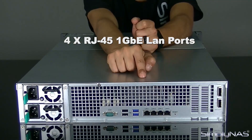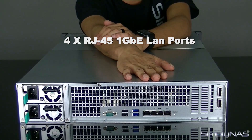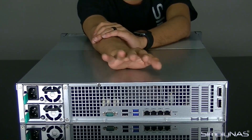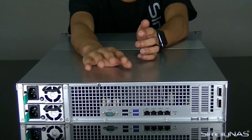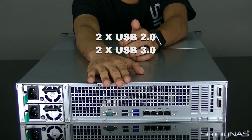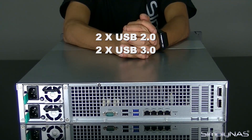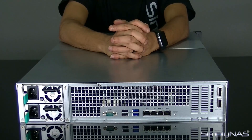Going through to the middle of the NAS, you've got four RJ45 ports, allowing you a four-gig uplink. These can all be aggregated together because they are on-board, so you have four 1-gig uplinks as well as four 10-gig uplinks available. Typically if you're running 10-gig, we only use the 1-gig ports for management. Right next to those ports you'll find two USB 2.0 and two USB 3.0 ports. The USB 3.0 ports let you attach an external hard drive to back it up to — or back the NAS up to — the external drive.